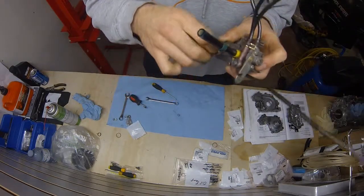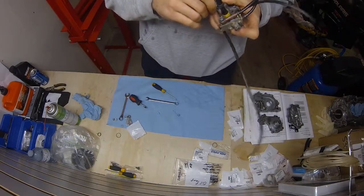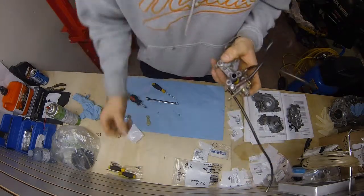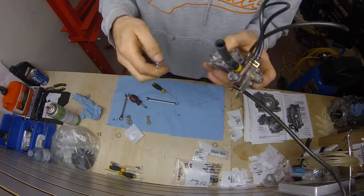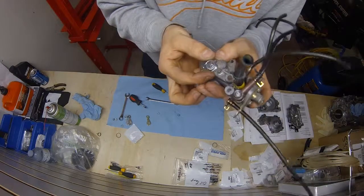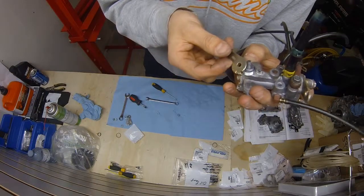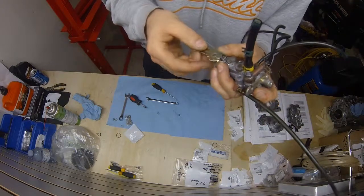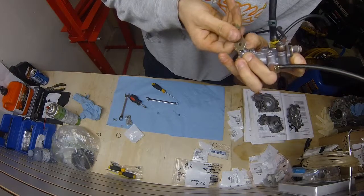So now that we got all the other pieces disassembled, bam. All right. So like I said, put that washer on. Make sure you seat that in there. Take your new spring, hook it around that tang there, your washer there. Take your tang, hook it into where it's supposed to go. Now a little play with your fingers here. Just give me a sec. Adjust it. Make sure that washer stays there.